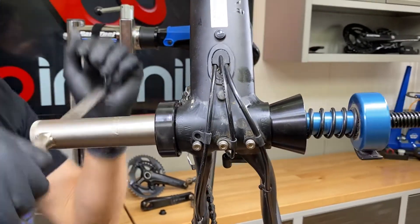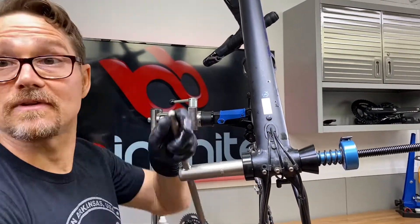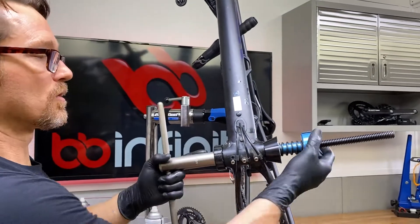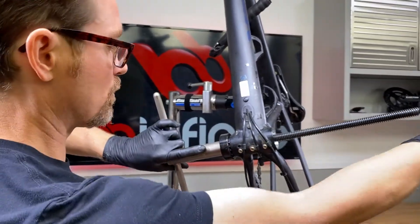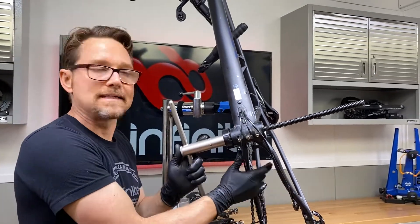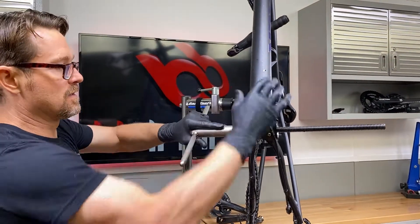It's almost home now. We already measured this ream — we know it's going to do 40.98 — so we're gonna be good to go. And that is actually done. No muss, no fuss. When you're taking it apart, go ahead and turn it backward, because it doesn't cut in that direction. We don't want to accidentally cut material as we're removing it.